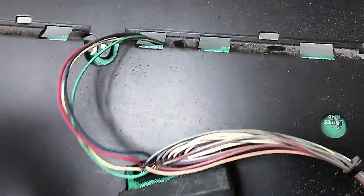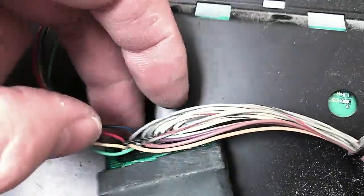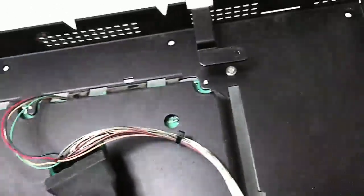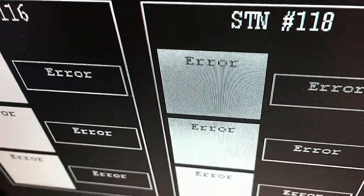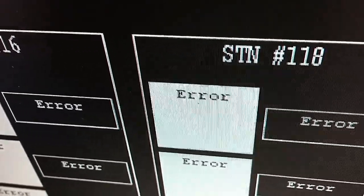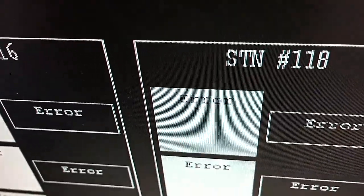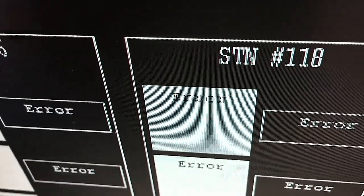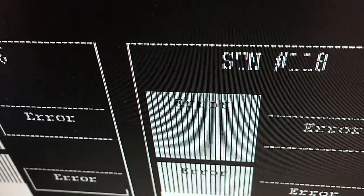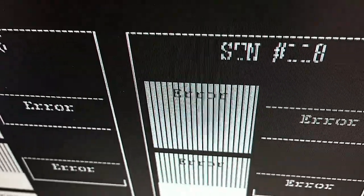I just want to make one note — I'll show you an effect. These cables back here kind of get a little old and brittle. When you're plugging it in, you're gonna wiggle a cable. If you get an old cable, see if I can make it do it — there, you see that effect. This cable's not too bad — oh, there it goes. So one of the cables has a problem with it, so we're gonna fix that, but it's not the monitor, it's the cable.